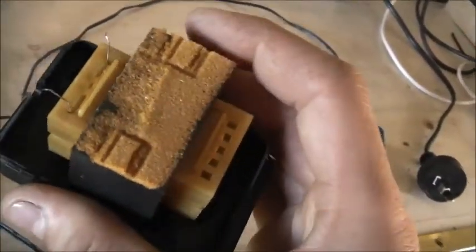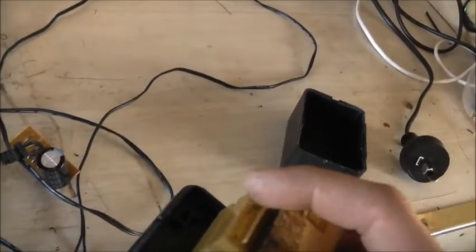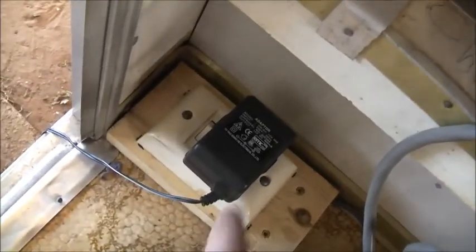Did try the 24-volt option on that zapper. 25 volts at the drop raised the zapping voltage a little bit by about 10 volts. This is just a cheap wall wart compared to the other one — a little Chinese no-name wall wart. It's under half a rated load, drawing 250 milliamps, and it's quite warm but it hasn't burnt out yet. That's keeping the desulfator on, which is keeping the batteries above 12 volts.